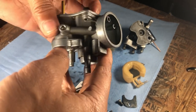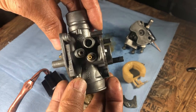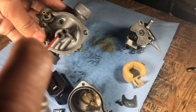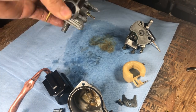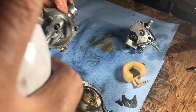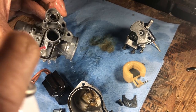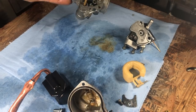It's actually really dirty in there too. After further inspection, we look through the holes — I can see through the holes. So what we'll do is we will just take carburetor cleaner and pretty much jet through all the holes, vacuum the line. I don't see any more obstructions in here. So we'll let that dry and then we'll inspect it. This is pretty gross right here. Let me get a brush.